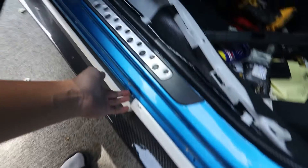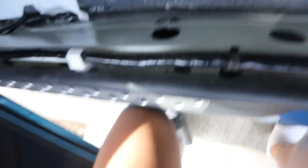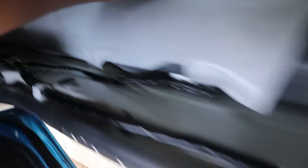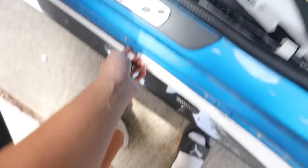I went ahead and drilled out the holes for the rocker panel just to make sure it works before showing you guys. And it works! So like I said, you can't really reach the back of this to put on a nut, so I took the hole saw and drilled out those big holes. Now I can stick an extension with the socket on it and come all the way back and tighten it up. Now that I know how to do it, let me go ahead and show you guys how to do it on the other side.